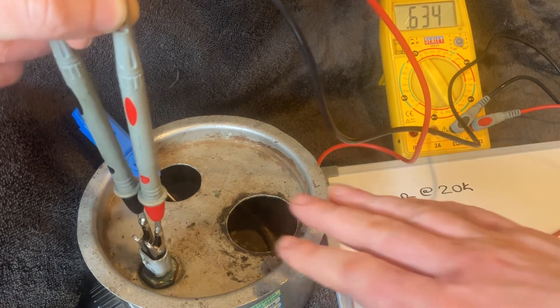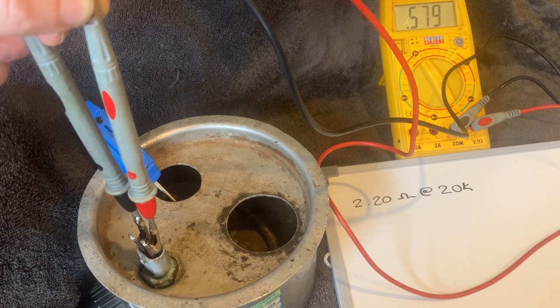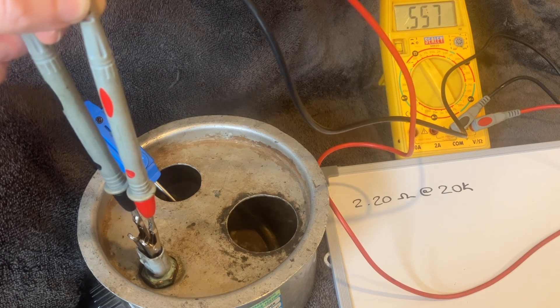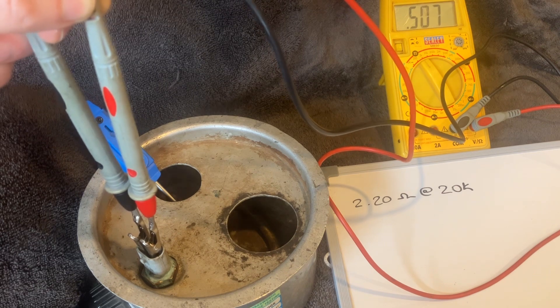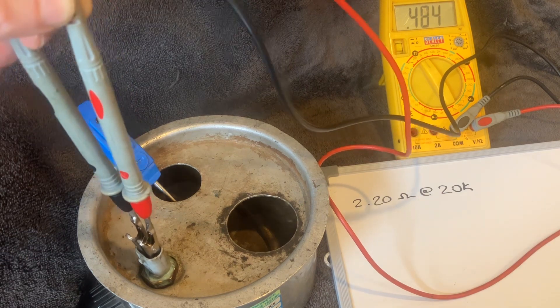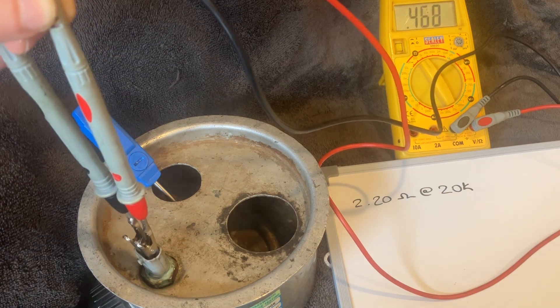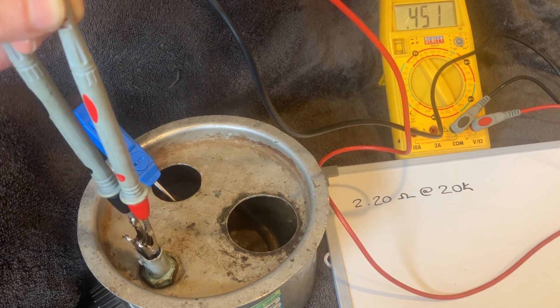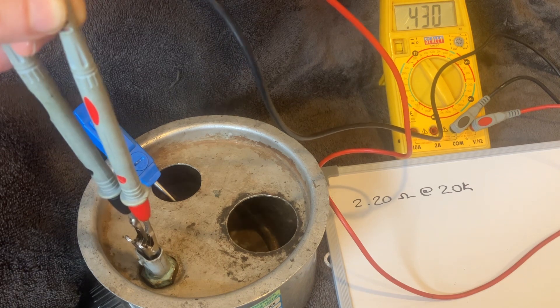This is a thermostat kettle, which is quite handy for testing thermostats or engine temperature sensors. I'm down to about 500 ohms and the rate of dropping is starting to slow. I'm looking for any dead spots — large sudden jumps down — but this sensor is dropping quite steadily, which tells me there are no dead spots within it. I think the sensor is okay. I'll let it bottom out at this temperature of about 90 degrees, which is the typical thermostat opening range.